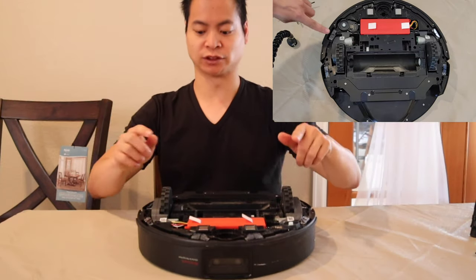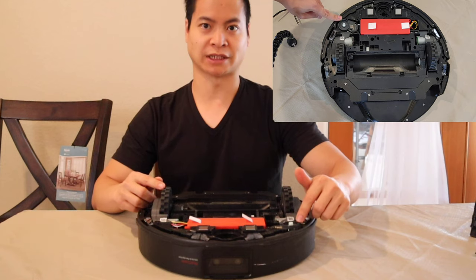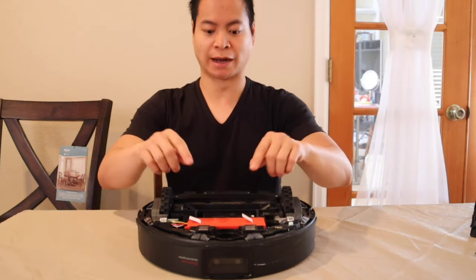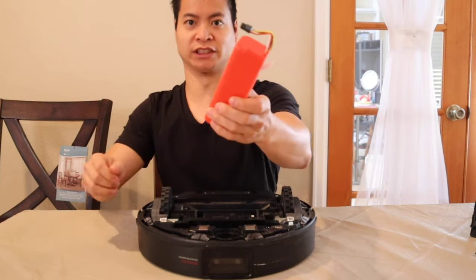I got the front wheel caster removed, the side brush removed, and six screws removed. Note the size of the screws — they're actually black, so make sure you put the right screws back in the base plate as they're a different size, or you could strip out the post. Now you can see the two drive wheels. I have the ability to remove the side brush motor and remove the battery. Before I go any further, I'm going to disconnect the battery — it's held by a pressure clip and it's really easy to remove.